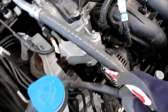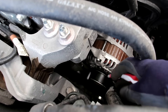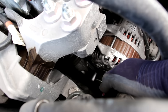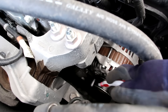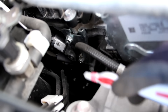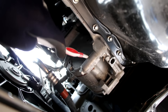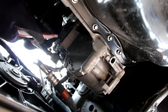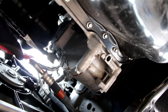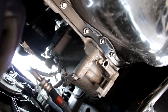Just in front of that timing chain is the drive belt setup. From the top you can see you've got clear access to look at the alternator and its drive belt, but accessing this area is pretty difficult from the top, so if you've got to change the belt or service anything here it's best done from the bottom. The water pump has its own belt that runs off of the crankshaft and it's located near the back of the engine. The AC compressor is pretty easy to remove — just four bolts — but you will have to drain the AC system to remove it in order to get the alternator out because that drops out the bottom.